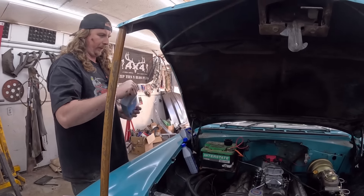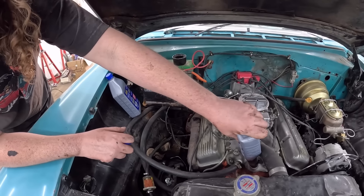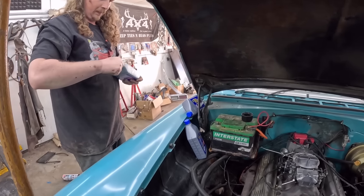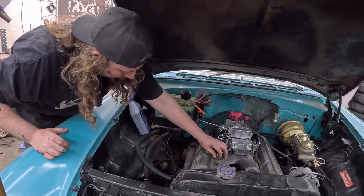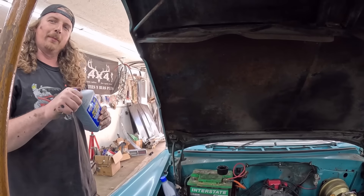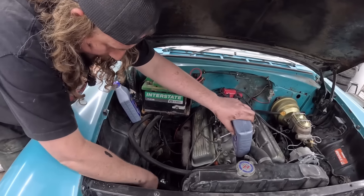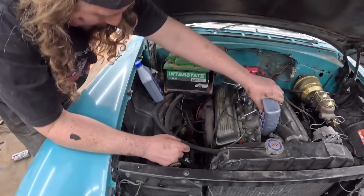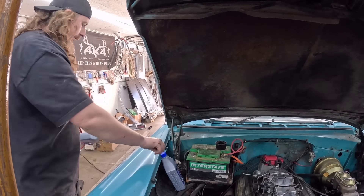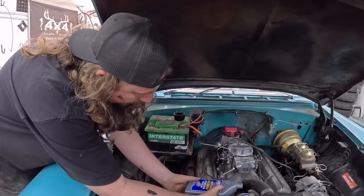It's down on the ground. I'll put the oil in — I always put the oil in first so you don't forget. Then — oh, there's gonna be some butt crack editing — so I gotta climb in the back and tighten up the shock absorbers. This doesn't look tight at all. That's the fuel line. I didn't think this thing had a fuel filter on it, but it does, so that's good. Everything's kind of decent. I put oil in the filter, so we'll put in four quarts to start, run it, see what happens. And then tighten the shocks.